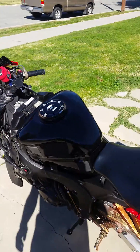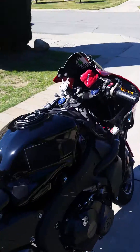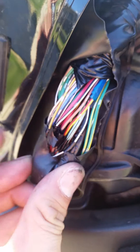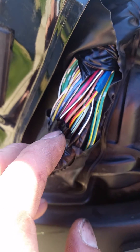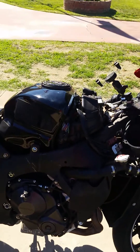I also noticed — and I'm guessing this was the real culprit — I was checking over my wiring harness. This black piece was all covered with black tape from the factory, and I noticed that these wires right here, about five of them, were all showing metal. So they must have shorted out right there, which probably caused my stator to short out.